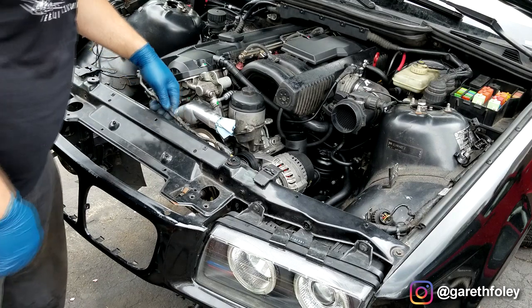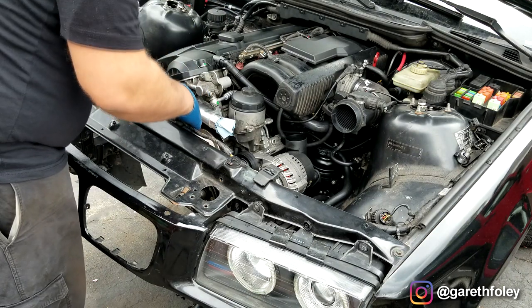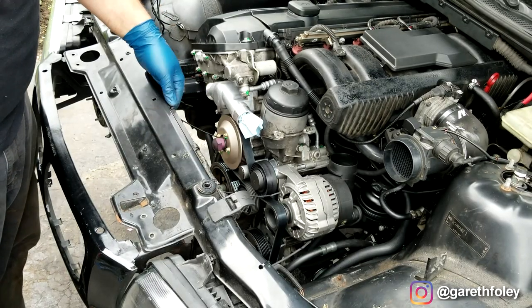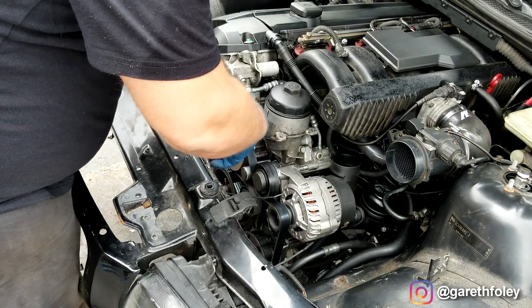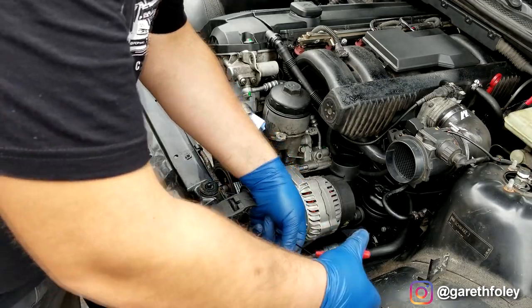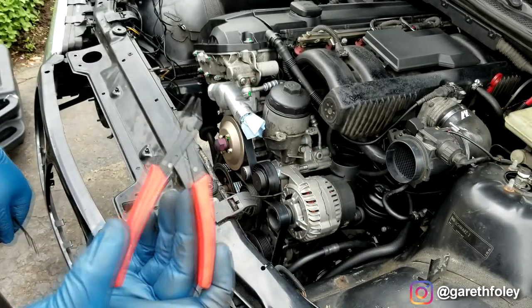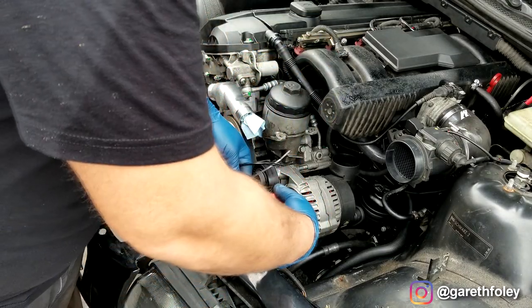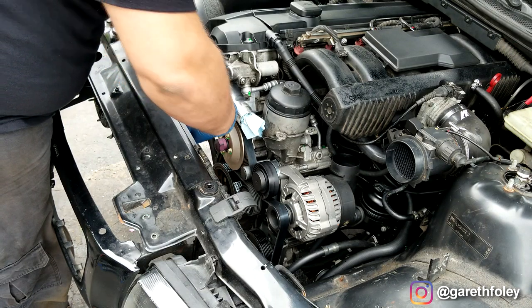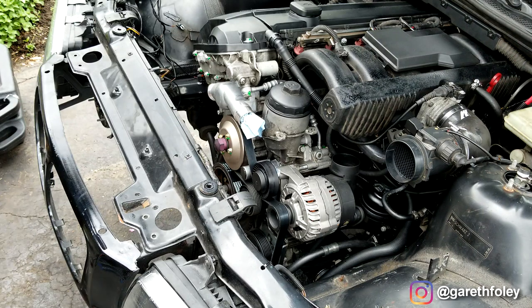At this point, it's just a matter of running the wires back to where they normally would have been. It's kind of just a game of backtracking. I went ahead and tucked this harness underneath the radiator support here, and a lot of these clips are broken, which is not really a big deal — I don't think those clips are that fantastic to begin with. So I used some zip ties. When you're dealing with zip ties and you cut them, do yourself a favor: get a set of flush cutters. Otherwise you will have some flesh cuts. Nothing is worse than cutting yourself on a jagged zip tie. They're cheap and keep you from bleeding all over the place — also makes for a nice, clean install.